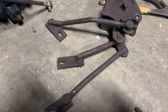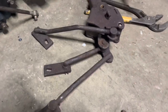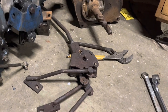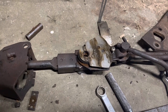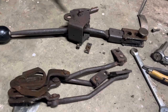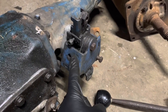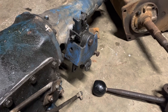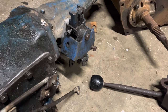For a minute there I thought maybe I could just lift this whole overdrive van shift linkage setup. Unfortunately, because it gets mounted up and slightly angled forward, they're all about a half inch short. So I'm going to have to keep going with this pieced-together setup I've got. Something tells me I'm going to learn more than I ever wanted to know about these today. Well, here's my genius plan: take all the guts from this one with the right size pivots, put them in this one, replace the missing bolt, and get everything cleaned, rebuilt, greased, and ready to go — all at the same time. That's going to be too good, if the later guts even fit.